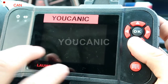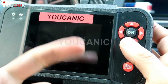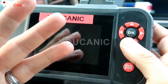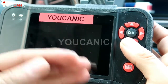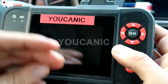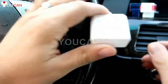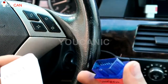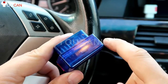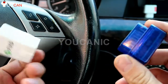The Launch Creader is a multi-system OBD2 scanner that will scan ABS, transmission, airbag light, and of course the check engine light. From all those modules you can read codes, clear them, and look at live data from sensors in each module. Overall, Fixed doesn't offer a whole lot more than a basic ELM327 adapter. Install a free app on your phone for about $10, and you'll have the same functionality as Fixed. Thank you for watching.